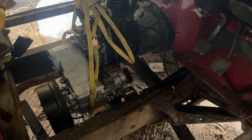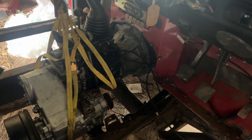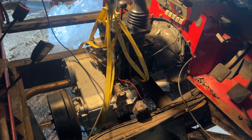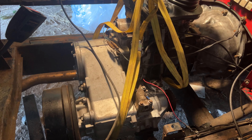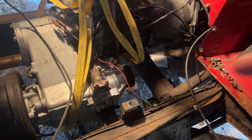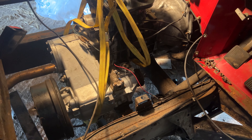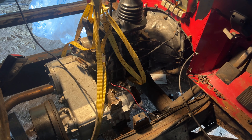I think the only way to get it back on is to remove the transfer box and the gearbox again so I can get back into the bell housing just there to put the lever back on. So after taking many days putting that all together, it's coming out again. I've strapped up the gearbox and transfer box, put a hydraulic jack underneath to take the weight, and I've already removed all the bolts around the front of the bell housing. The drive shafts are already off both sides, so hopefully we can just slide the box back slightly and get into the bell housing — if not, I'll have to take it all out.